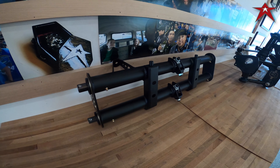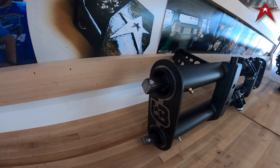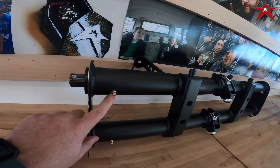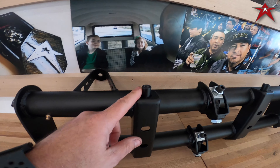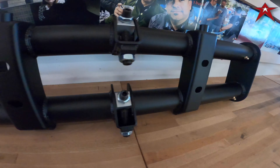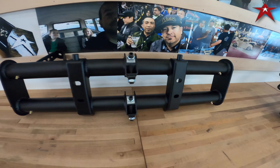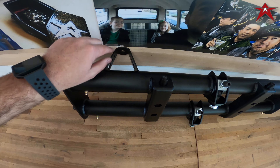This is the shockless version, so as you might understand it does not come with shocks. Some of the details about this specific beam: it comes with Delrin bushings, UBI plates, greasable zerks, slotted uprights so we can get it dialed in left to right, body bungs, our game changer adjusters that give you seven and a quarter inches of adjustment, a little steering box locators, and we offer this with torsions and tie rods should you want to get a package. It also comes with the steering adapter bracket and all necessary hardware.